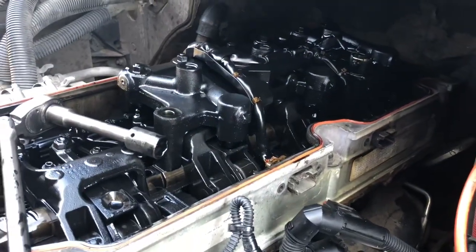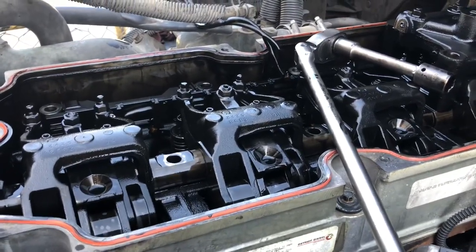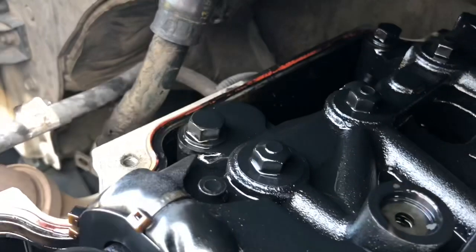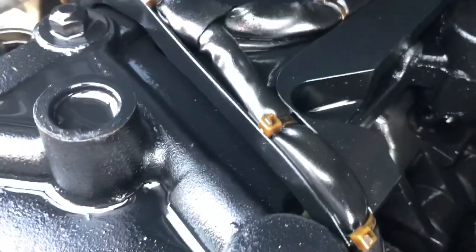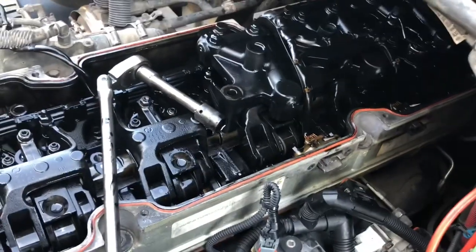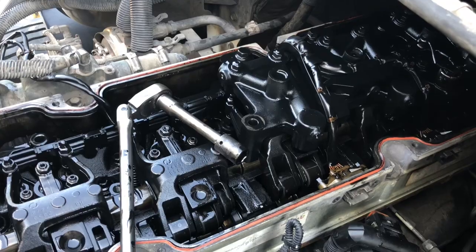What I'd like to do is get rid of the jake brakes, get them out. We're gonna torque everything down minus the jake brakes and start our valve adjustment. All you're gonna need to do is remove some bolts on the jake — one, two, three, four — and there's a little hidden nut right back there you can use your 18 millimeter on. Remove all six bolts and the nut, and that'll let you take out your jakes and give you access to your rocker arms.